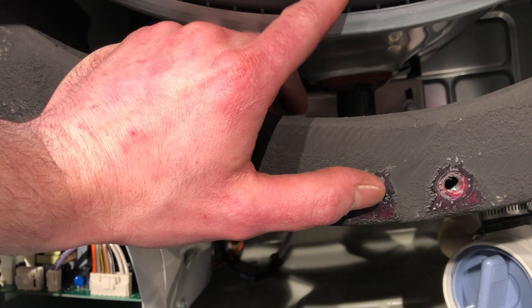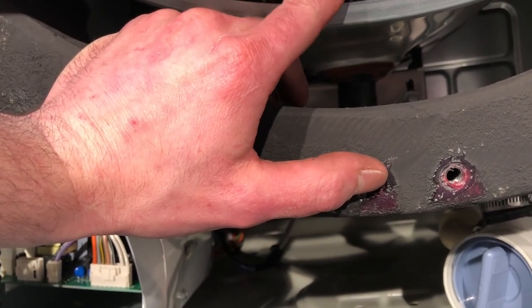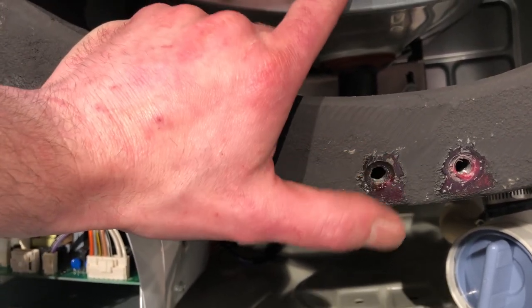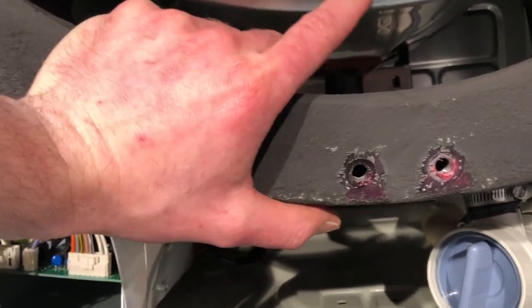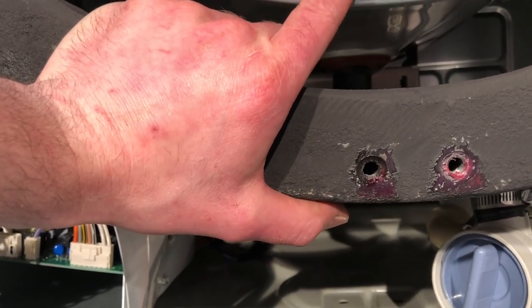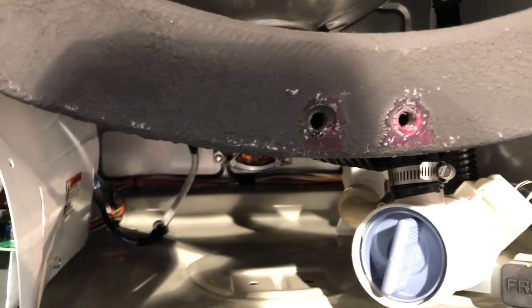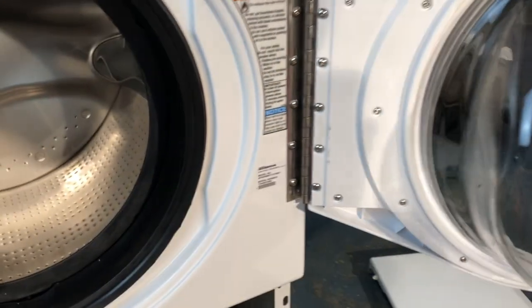You'll see this huge outer balance ring. Speed Queen did something pretty clever: aside from the external front weights, they have a balance ring inside the spin basket that is full of ball bearings — similar technology used in truck tires — and it really helps to smooth things out. With all this in place, the Speed Queen can still go off balance, but it's a pretty rare event. I personally had this machine in my house for well over six months and I think it went off balance maybe once or twice. I simply restarted the cycle on spin and everything worked itself out.